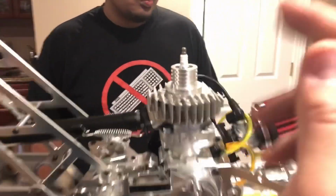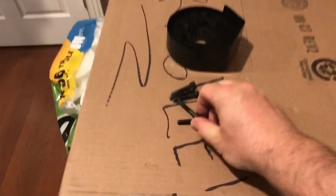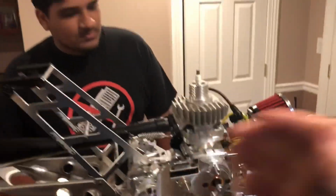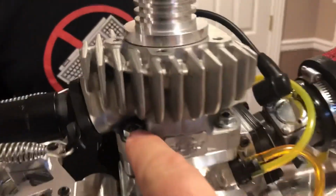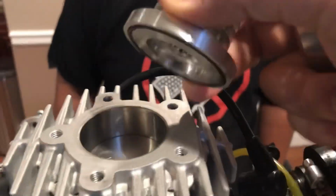Oh yeah, another thing, there was no Loctite whatsoever over here. Most engine builders don't use Loctite, they torque stuff, but we will be putting Loctite, right? Because I've had many bolts in the past and other engines just come loose on us, especially after break-in. After a couple of heat cycles, things get loose on you. This engine is easy to retorque, but I can't retorque these studs here, these bolts, it's gonna be a bitch. So I'm just going to torque down this dome here, this cylinder.